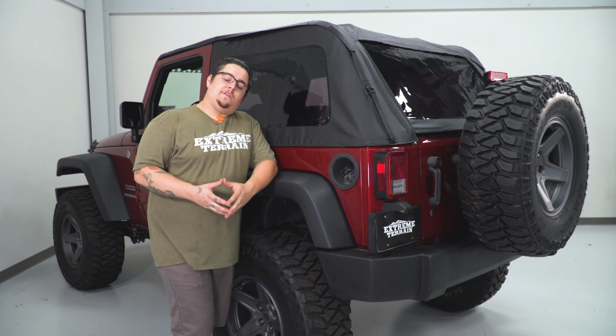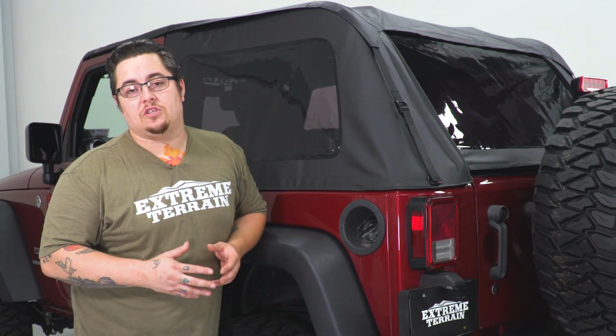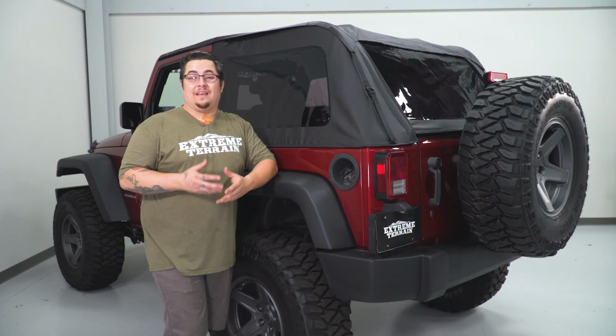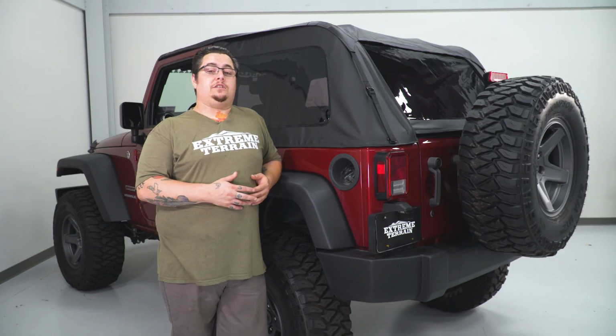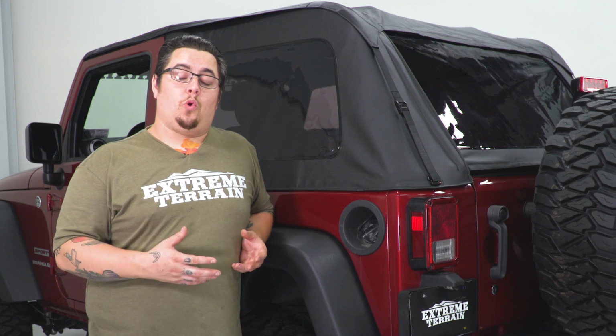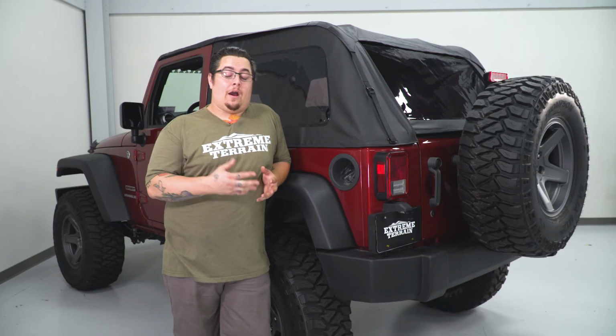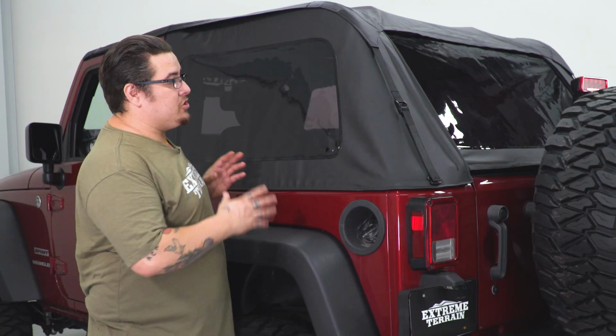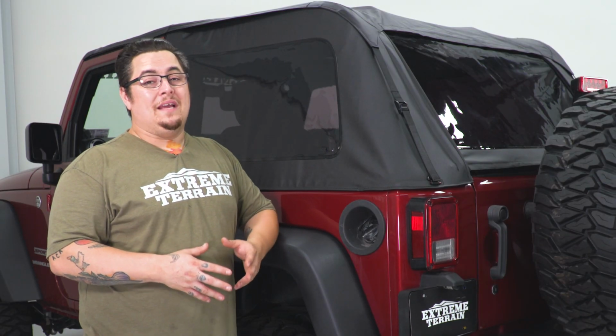Now, I hope you enjoyed this video and it showed you just what it takes to install this soft top at home in your driveway or in your garage. Now, if I can say one thing as a tip to help you do this installation, do it outside while it's warm and the sun is beating down. Now, I know it's gonna be a little hot, but the heat from the sun will make the soft top a lot more pliable and easier to stretch.